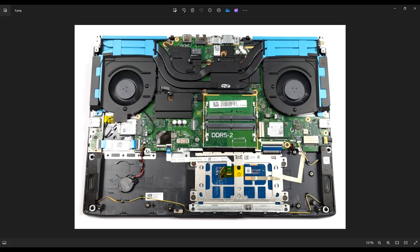So now that the battery has either been removed or unplugged, it's safe to move deeper into the computer. This is your Wi-Fi card here, guys, on the left, underneath the left hand fan in this picture. It's plugged in right here, held in by a single screw on this side. And these are the antenna wires — they snap onto the Wi-Fi card, wrap around the fan and go through the hinge assembly. These are snaps, not plugs.